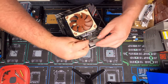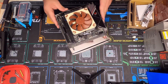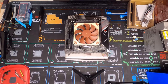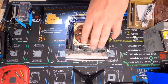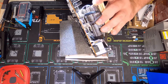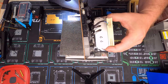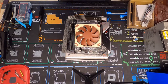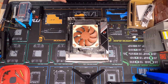This right here is our CPU fan header — flip this around and plug that in. CPU cooler is installed, piece of cake. I'll also get a flashlight out. I want to see squeeze-out on my thermal paste all the way around. Right there — you can see this thermal paste squeezed out just a little bit around the perimeter of that pad, and that's what I'm looking for. That basically tells me I got a good, even layer of paste.